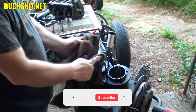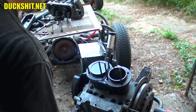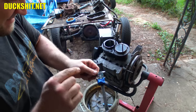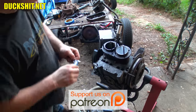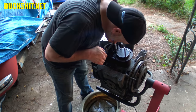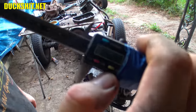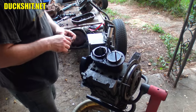I guess we're going to get the calipers out and see what our bore and stroke is. Just looking at this, it looks pretty factory — at least 1600. Got my trusty calipers here, the ones I always manage to lose the battery cover on. With a piece of tape I can get them working again. Let's see what our bore is — I'm seeing 85.5mm. I'm going to speculate there's no reason anybody would turn this into a stroker if it's only 85.5mm. Let's make sure this cylinder is at bottom dead center and stick our depth gauge down in there — it says 70.5mm.